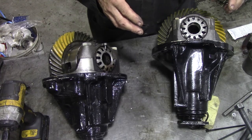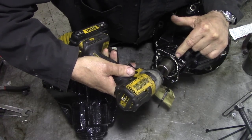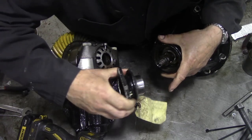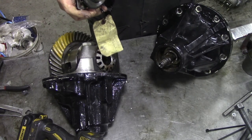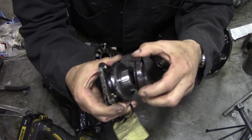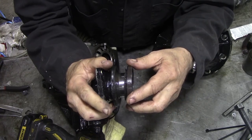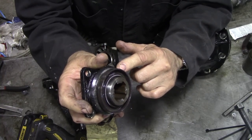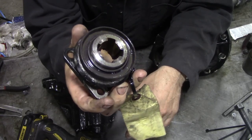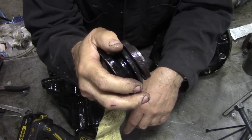But what happened was, when I put the cover back on here, the seal - this differential was tight. I had to take the oil seal out to get it to turn. The oil seal here is hitting on the back of here. Apparently there is an oil seal for one type of flange and an oil seal for another. I don't know which is which. But when this was tightened up, you had a really hard time to turn it - you had to turn it with a half-inch drive ratchet. It shouldn't be that tight.